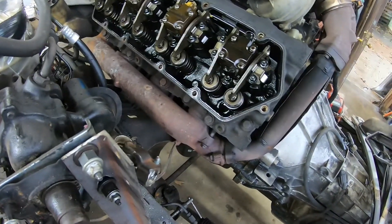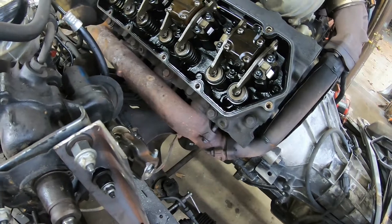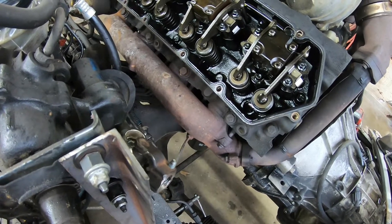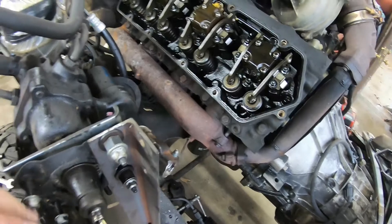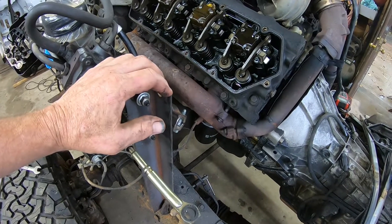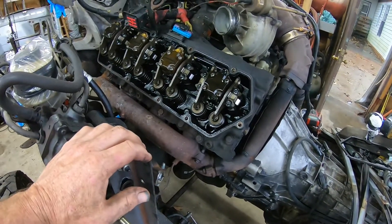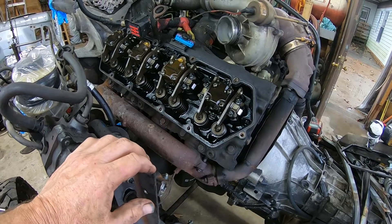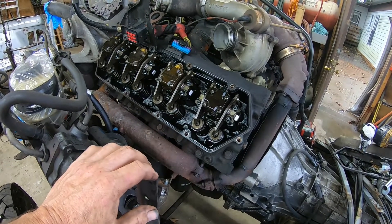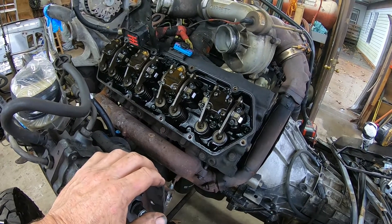I guess that's going to mean I'll have to get a full set of O-rings, because I'll have to pull the injector out to take that top bolt out so I can clean the threads, loctite it, and torque it. Then put the injector in and set the torque with loctite. When they come loose, the injector lifts a little bit and the cup can lift from the compression of the engine, and then you wind up with combustion gases coming out through the coolant.